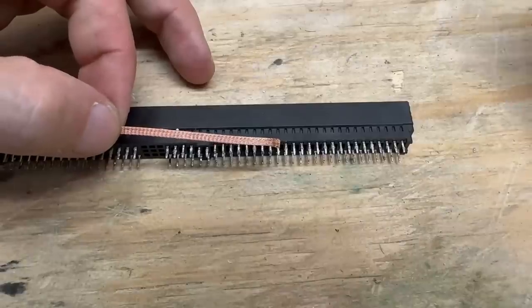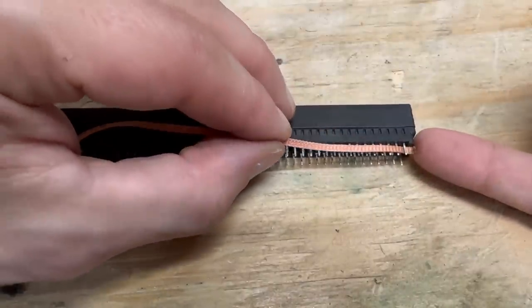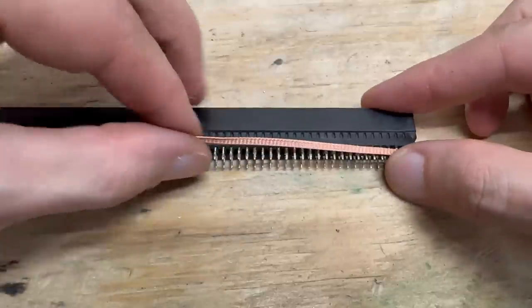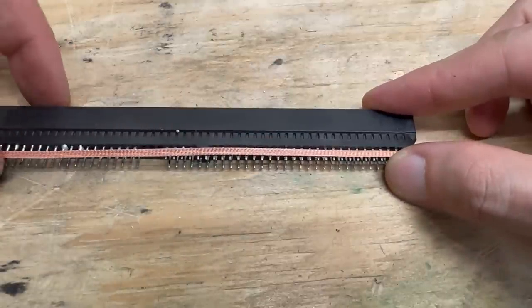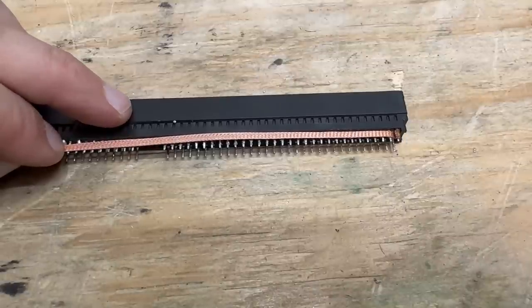And there we go. You can see how the desoldering alloy breaks the bond of the existing solder — it wicks down just enough to get in between the existing solder and the solder pad. The idea of doing it this way is you get to use much lower temperatures, therefore it's much safer for the board and it greatly reduces your chances of pulling up a pad. Now I'll just use the desoldering braid to clean up those pins — take the braid and hook it onto the end of one of the pins and then just pull it along. These desoldering braids can get pretty hot, pretty fast.